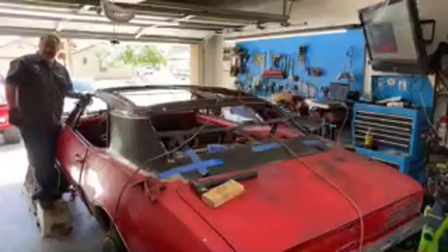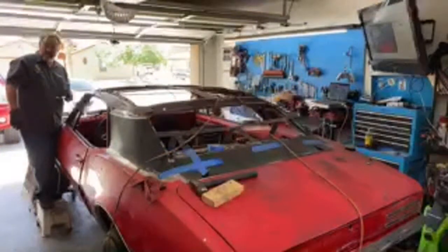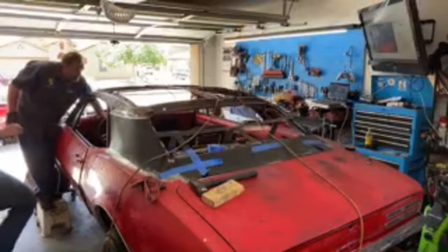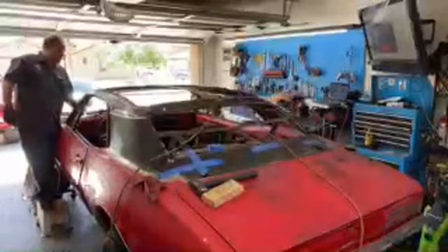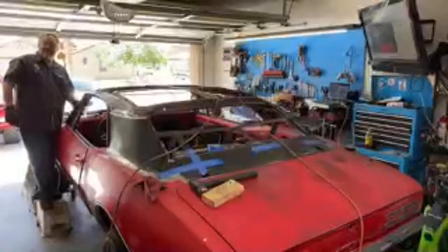Do you have to have a steering wheel puller to pull it off? When you talk to the guys on there, they say take the nut all the way off, put it back on two or three turns, and you can lean back in the seat and just pull like that. Sometimes it'll pop off. Okay, but by the book, the answer is yes. It's a taper fit, so there's a bigger nut behind this. Take the horn cover off probably, or take the steering wheel loose from here. It might be an adapter. It's about a 15/16 nut, 7/8 nut, somewhere in there. Socket, that's it. And if not, there's a puller that you're supposed to use. Don't beat on the steering shaft.